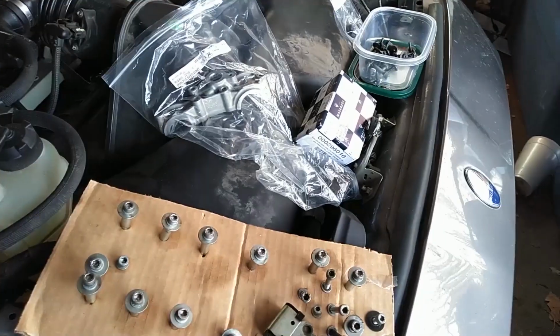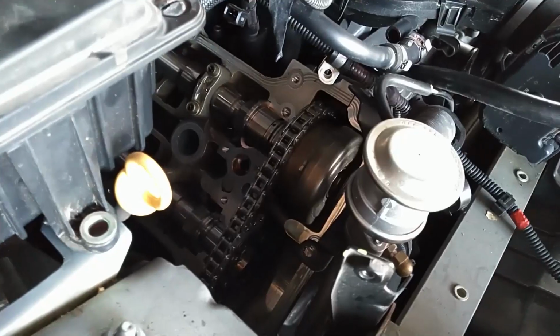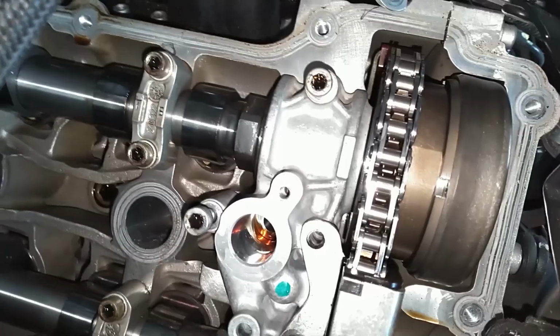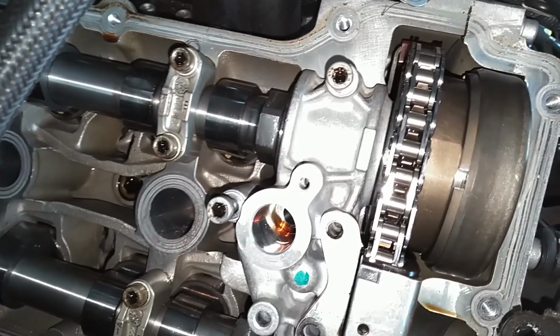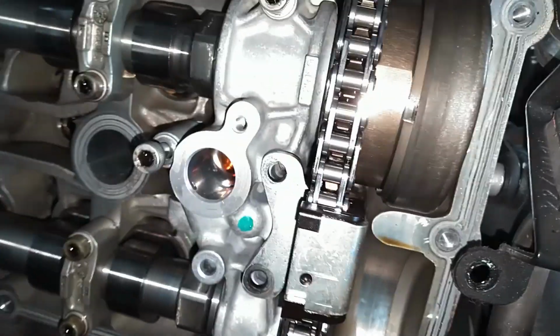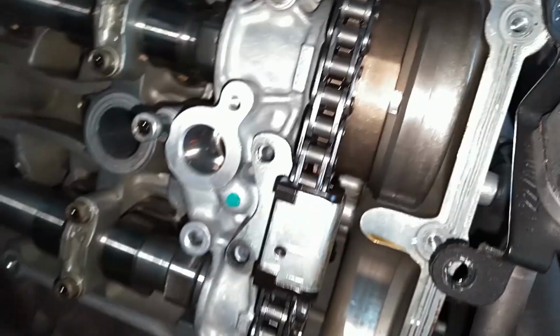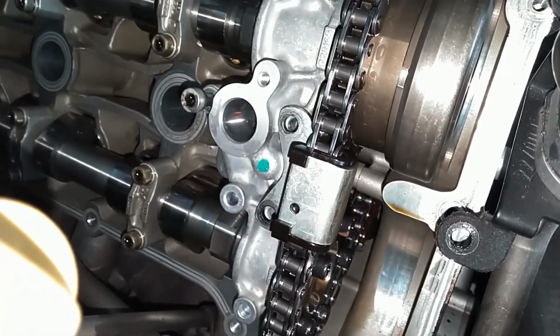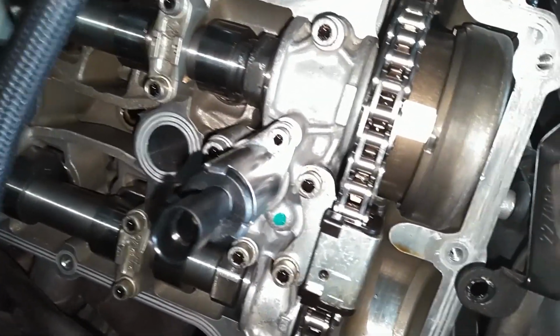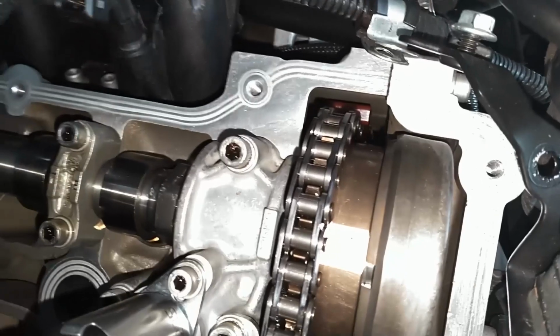Make sure that's not bunched up before you go setting that back down on the engine. Now I'm ready to put this in place, slide the spacers through the hole, and start to screw that down. I worked the valve cover in place. I pulled this to the side, got that under there. I had to massage the oil sensor through that gasket. Now I have to reach back there and feel to make sure that the back of that gasket didn't come out of that valve cover before I slide these screws in here and start to screw those down.